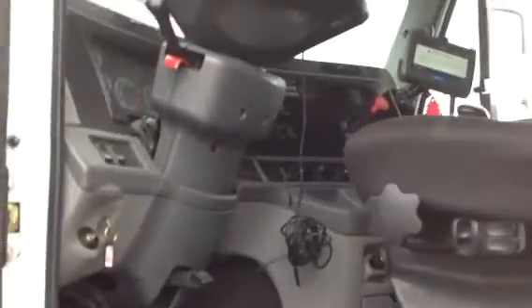We're going to plug in our electronic service tool to the truck. This is a 9-pin connector. We'll go ahead and connect it to our laptop. Our laptop has the Detroit 60 series original equipment manufacturer software. We're going to go ahead and open up the switch so the truck can do a self-check before we turn it on.